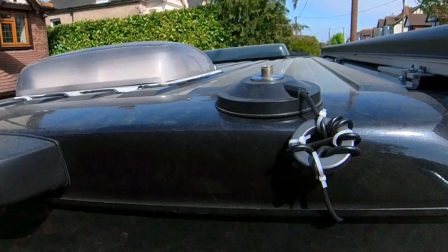I've used a seven-inch magnetic mount, which you can see here on the roof of the vehicle. It seems to work quite well. It's primarily designed for VHF and the higher HF bands. It certainly works well on 20 metres, and I suspect it will work okay on 18 MHz, 24, and 28 MHz. So I don't anticipate any problem. I've got some interesting antennas to check on that, which I'll come back to in a future video.